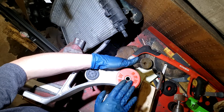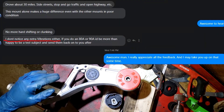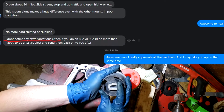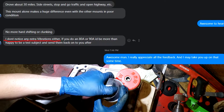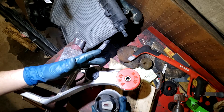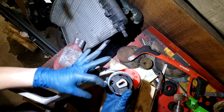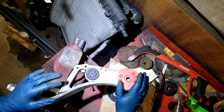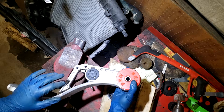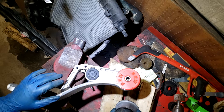This does still have some flex and some give - it will still absorb vibrations. It may cause slightly more engine vibrations into the car because it is more firm than the OEM one, which is very very soft. At an idle when it's brand new the OEM one is great - it absorbs all the vibrations. But as soon as you give it gas or it gets some age on it, it flexes and allows the engine to move way too much. This polyurethane bushing is a nice happy medium - it still absorbs some vibrations but it's way more secure, more durable, and should have a much longer service life.